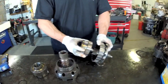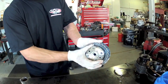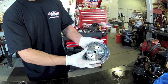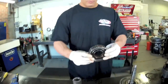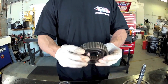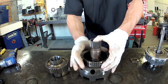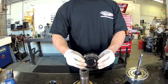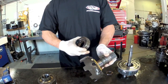Your overdrive sprag — holding it like this, it's going to rotate counterclockwise and lock clockwise. Now with these sprags, they're called a dog bone element sprag. What they're designed to do is freewheel in one direction and lock in the other. With a lot of power, these things can roll over, so you want to do everything possible to keep them from breaking. Some surface preparation goes a long way.